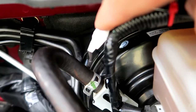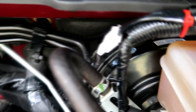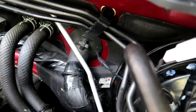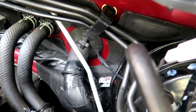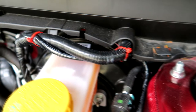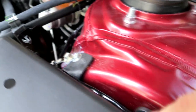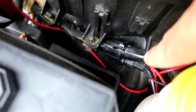Because this big connector doesn't fit, it's going to go through the firewall, so you actually have to cut. You see where I put the black tape there — it's three wires. I cut, connected them, after I ran the wire through the boot. I ran this wire to the switch from inside the car, around here, down through here, behind the fuse box, down beneath the fuse box. And here under here is where the relay goes.